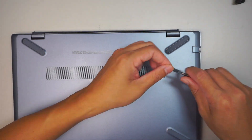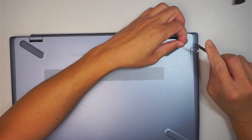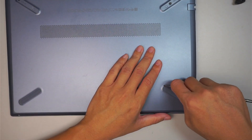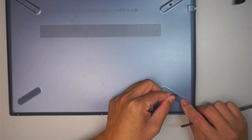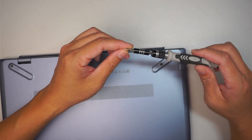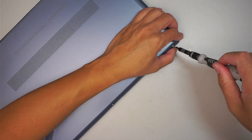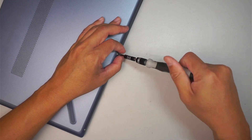The first thing I like to do is pry open the rubber stopper here — this is what prevents the computer from sliding. There are hidden screws underneath them. You need to peel this off to get into the computer. I'll be using a PH double-zero, which is a tiny little screwdriver, to remove the screw here. It looks like it's already popping up. I'm going to remove the screws.